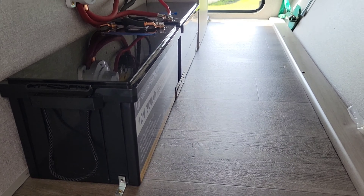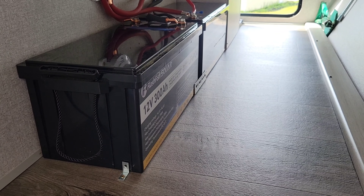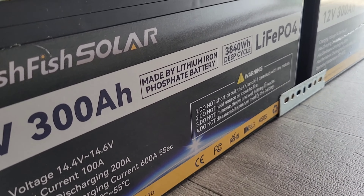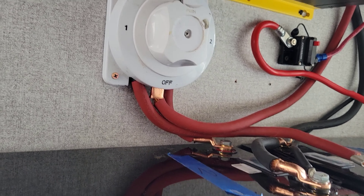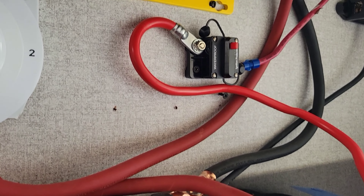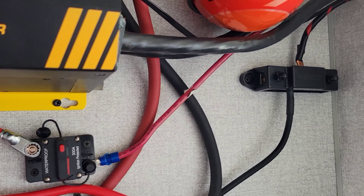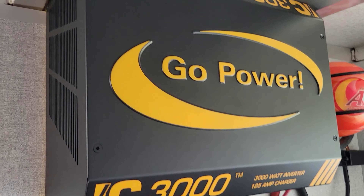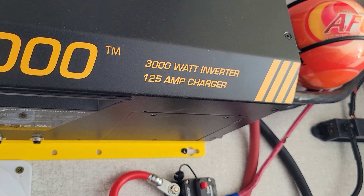Before we get into the inside, we have two lithium batteries, 300 amp hour a piece, comes out to 3840 watt hours. Double that is your total watt hours. They're both tied into a one-two battery switch. The small breaker is for the 12 volt house batteries. I did install one of my automatic fire extinguishers. And this is a true 50 amp inverter. I had to go with this one just due to the lack of 50 amp inverters. Has a 125 amp charger.